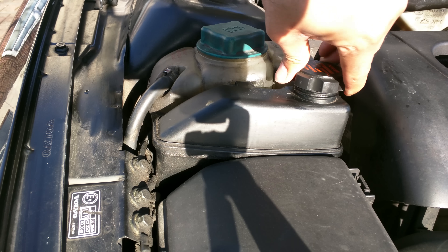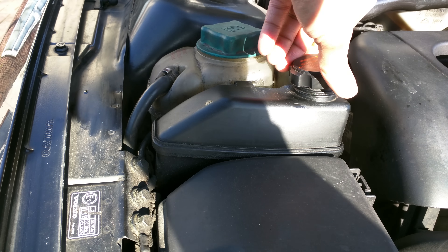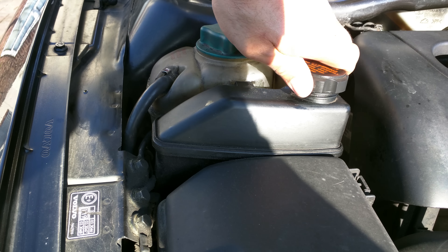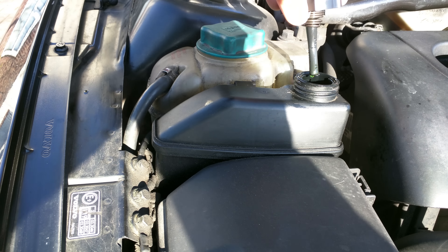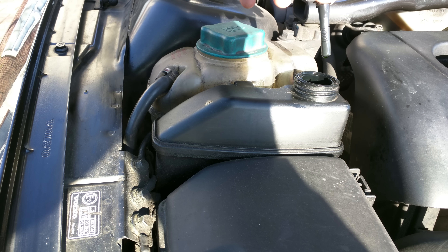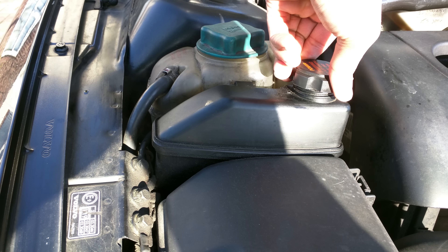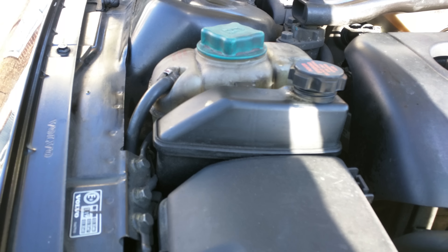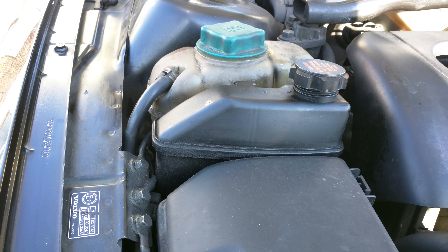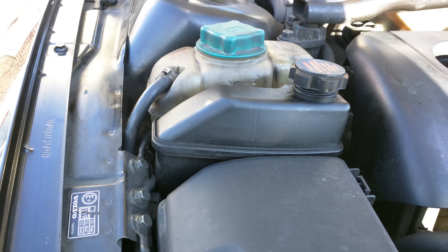I'm going to double-check the level. If your power steering fluid is in really bad condition — very dark, very burnt — you may need to do this drain-and-fill four times; I've only needed to do it twice. If you do it yearly, you should only need to do it a couple of times each year. I'm at the right level on the cold fill — lovely and clean and green. I'll drive the car around for a couple of days and if it's still green, that's me done for another year. If you do four draining fills, it will remove 90% of your old fluid, so you shouldn't need more than two litres, but maybe have three litres on standby just in case. And it's as simple as that — I hope you find that useful.